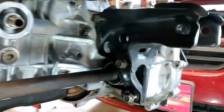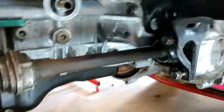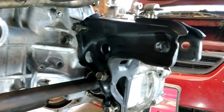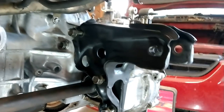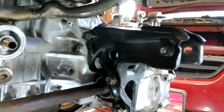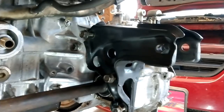This is the rear motor mount — it connects with a bolt here, bolt here, and one more up at the top. The back part goes down over the mount that's on the frame, and then the bolt runs through and screws in. If I didn't have to do so much finagling to get this in under the AC lines, I'd try to leave it on loose. But the engine is going to have to go in with the transmission side dipped down and the pulley side tilted up, so I'll just have this off completely and finagle it into place after the two side motor mounts are connected.